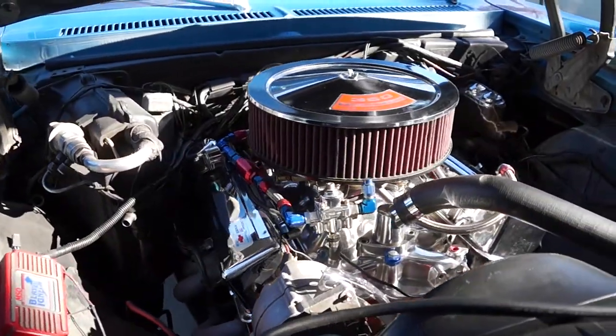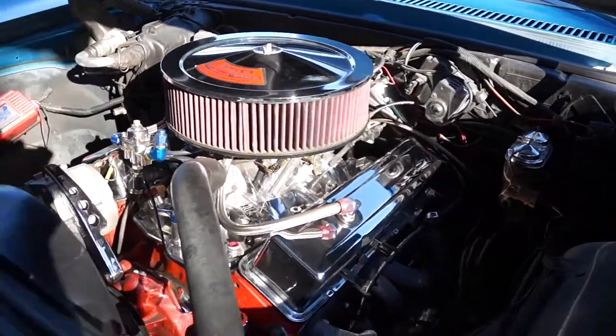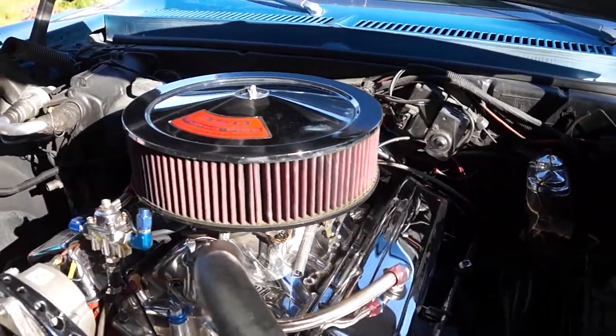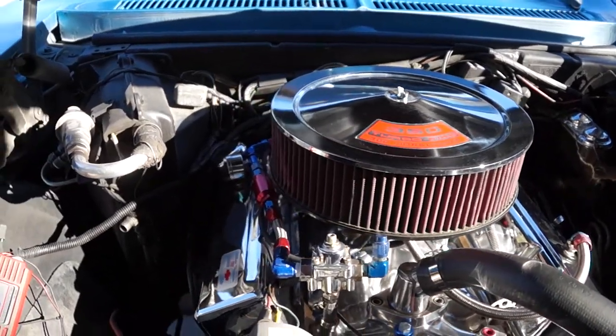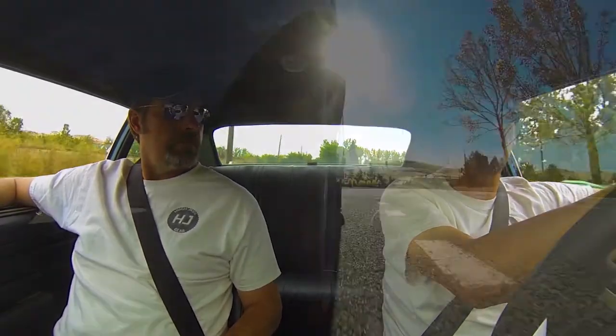The engine is a 350, 30 over. It's been fully balanced. It's got a good bottom end. Good rods, good crank, fully studded, windage tray, crank scraper, 7-quart pan, all that. It's got good 202 style heads on it. Flat tops, about 9-to-1. Relatively mild cam, probably in the 460 range somewhere in that. It's got 1.6 rockers on it. Makes an honest probably 360 to 370 horsepower.